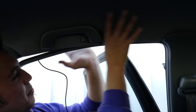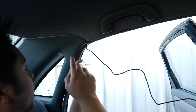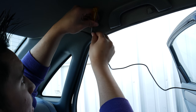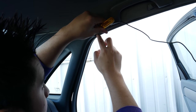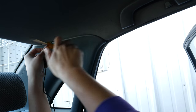If your rubber seal easily comes off like in my brother's car, you can lift it up to wire through a little bit easier. I'm going to keep this on and keep pushing through. Once we reach this metal part right here we're going to route the cable through towards the back and the trunk. Same method as before — push down with the flathead and twist.